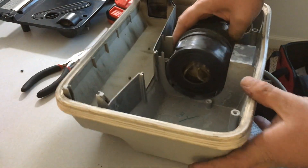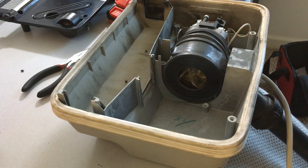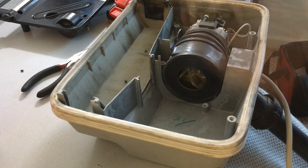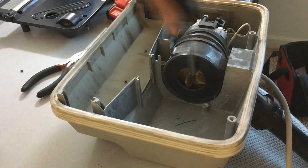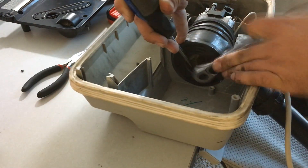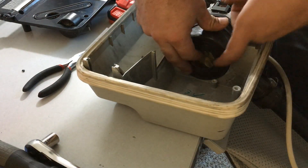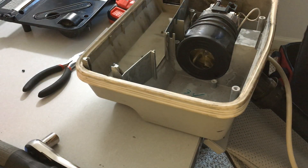In order to remove the fan, this might seem a little tricky at first, but it's reverse-threaded. What you're going to have to do is tighten the nut — basically turn it clockwise. What I like to do is put a screwdriver on one side and the ratchet on the other. It is a size 11 nut — just turn it a couple of times and you're done.